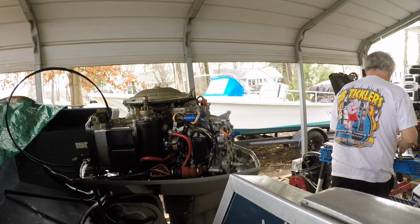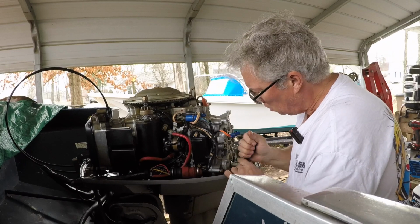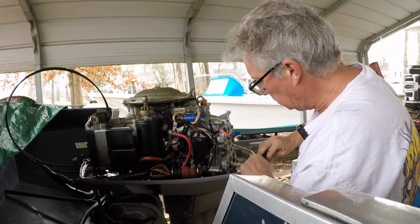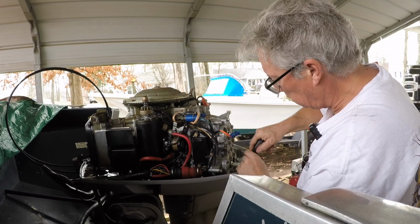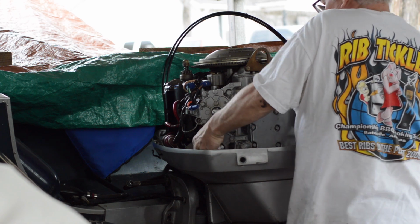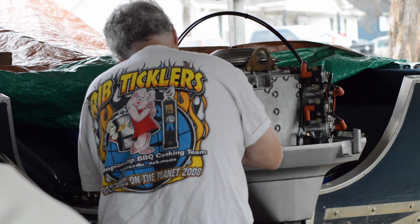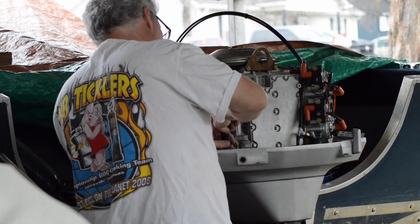So now that we got it broke loose, use like a wobble. And since you're on a wobble, just go real slow, because you want the bolt kind of wobbling too. That's why I went to a 1/4 inch. Like with a 3/8 drive, it could be not good. Problem is, you can't really get your hand down in there. And I know you guys can't see this, but you just gotta trust me. Yeah, they look a little rusty. We'll see. Probably really should do new head bolts.